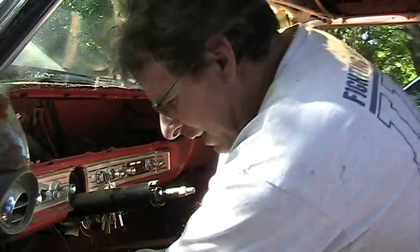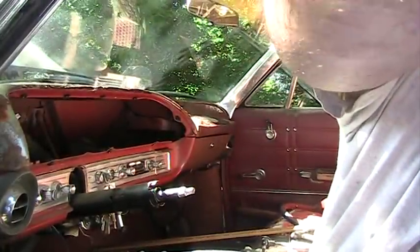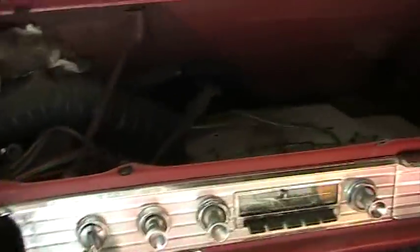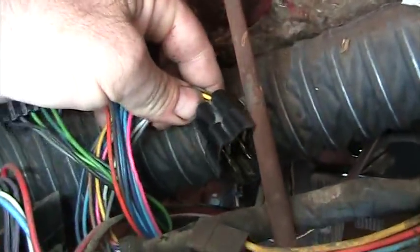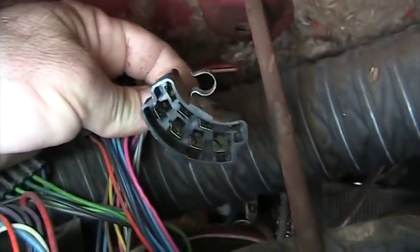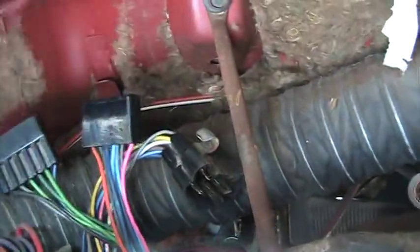Anyway, that's what I'm doing right now. I'll show you some more stuff on this thing. I took off my dash pad — my dash overlay cover — to get that speedometer housing out. The harness where the turn signal switch clips into was that little metal clip that was clipped onto that post. I couldn't see how it was clipped on and I couldn't get my wires to remove from there. I didn't want to break anything, so that's why I went ahead and took the whole cluster out.